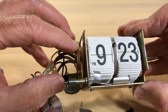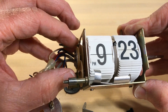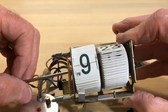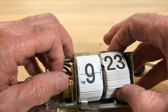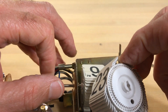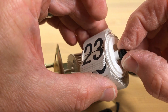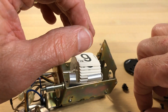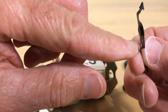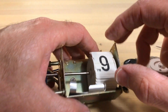There's another E-clip and washer, and then this thing comes right out. It has a flat spot so it turns with the post — those two indentions fit right into this spindle and spin this whole thing. Once I pull this out, that disengages the minute wheel from the hour gear train, so you can screw things up just by turning it a little bit. Pulling this out releases the minutes and also releases a spring device — the tile hour holdback — that holds back the last tile until the last minute drops. It also serves as a spacer between the two wheels.